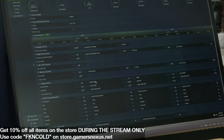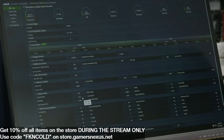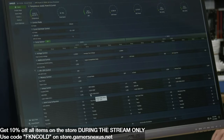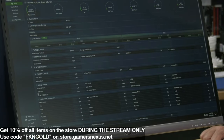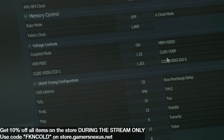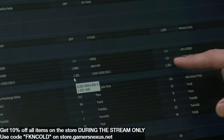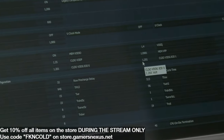All the voltages are set here: memory at 1.4, 1.4, VDD MISC at 1.35, and VDDG at 1.2 which ASRock is setting. Important note: VDD MISC needs to be probably 75 millivolts or more higher than VDDG because it feeds VDDG. This particular BIOS is setting VDDG at 1.2 and VDD MISC at 1.1 out of the box, so just be aware of that. You can see all the VDDG voltages for IOD 1, CCD 0, CCD 1, IOD 0 - all sides of the link covered.